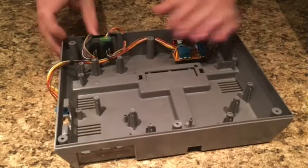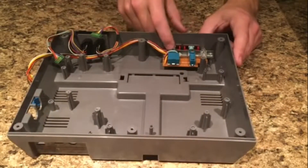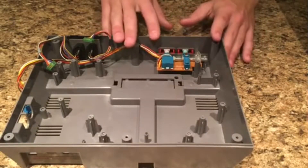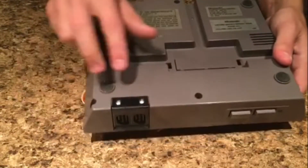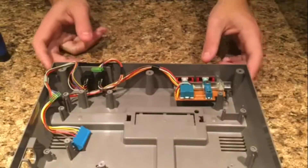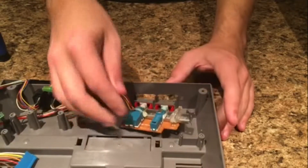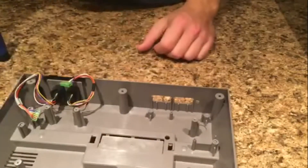This piece of RF shielding probably came loose while you were unplugging things. You can just go ahead and lift it out by itself — that's washable as well. Now you're down to the little wires and trinkets that are left. First we're going to take out the power button and the little light. There are two screws on each end of it — these are silver screws and a different length, so note that. Also turn your console upside down and you'll notice two more silver screws there — take those out too, making sure to separate them since they are two different types. This piece lifts up and pulls out. Sometimes they're more difficult — the last NES I did I had to fight it — but this one pulls out easily. Obviously it's not washable, so set it off to the side.